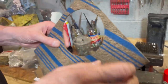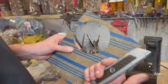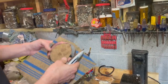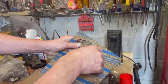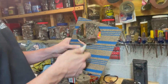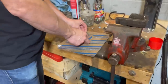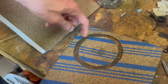So what I did, I laid down the cover for the oil filter housing, and I traced around it, and then I used a razor knife to cut my tracing by hand. That cut out a circle about like this, a little smaller, right? So I just cut between the edge and about a quarter inch, 3/8 of an inch that I needed all the way around. So this is extra stuff. This is what's left of the sheet. And this is how I got the gasket made. So basically, outside edge, go in about 3/8 of an inch and just cut around. So if you look here, what we end up with, I don't know if you can see that, maybe that's easier. This here, that's the gasket I made.